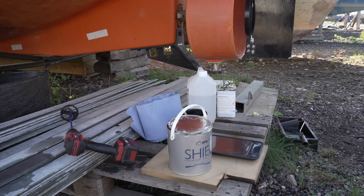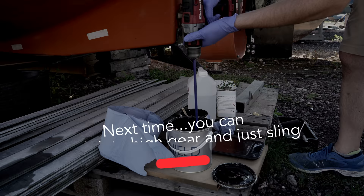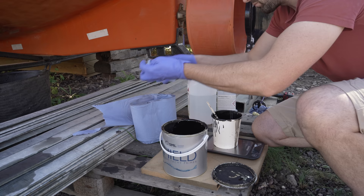The two-part epoxy primer needed a good stir once again to recombine the resin and the pigment. Thanks to a viewer for the tip to get excess paint off the stirrer — switching the drill onto hypersonic superfast mode did the job fine. This is also a reminder to be careful as you near the end of two cans of two-pack paint. There's always wastage as you measure out paint, and it might mean one runs out just before the other — risking ending up slightly short of resin or hardener, and having to throw away the whole lot if already part-mixed.